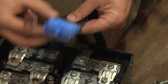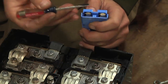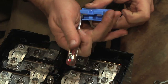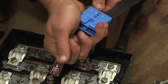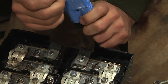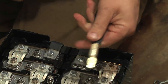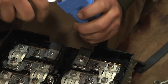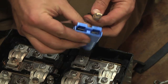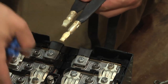Here's a fun little trick with these Anderson connectors - you can see the two conductors inside. You can actually pull those out. There's a little spring inside, and if you push it down with a small screwdriver, you can release the connection from in there. It helps if you push it forward a little first, push down that little tiny spring, and give a pull - and it comes out. There's a little tiny hook on the back and that little metal spring clicks into place. These two will just go together and make a complete circuit back to the front of the pack.